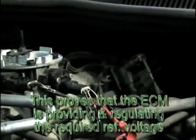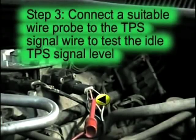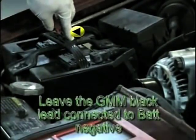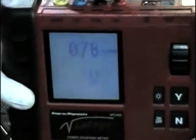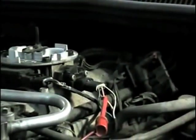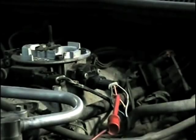Step number 3: Connect the graphing multimeter lead to the TPS signal wire — this is in preparation for our TPS idle signal test. Compare the TPS idle signal voltage value to proper specifications. This is the closed throttle TPS value, which will be interpreted by the ECM as a closed throttle input signal. In the event that the TPS closed throttle signal is off, perform a minimum air rate adjustment, which will be explained further along in this video.